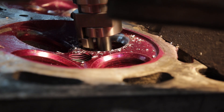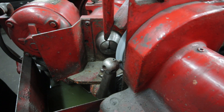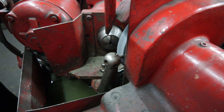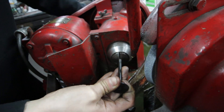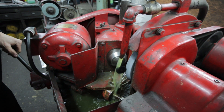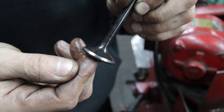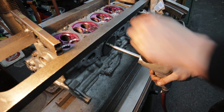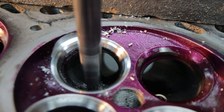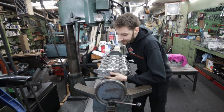So we've got the seats recut and polished. Now it's time to grind the valve to make sure it makes a perfect seal. The tool is set to a 45 degree angle and Nick redresses the grinding stone to make sure it's a good surface to begin with. After he's happy with the grinding stone, Nick loads the valve into the holder and grinds a new sealing surface into the valve. Now it's time to test the seal - we drop a couple valves into the head and apply a vacuum to verify the valve is making a perfect seal, which it is. After repeating this process for all 16 valves, the head is set aside and we move on to the next step.